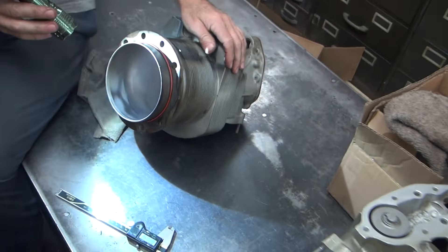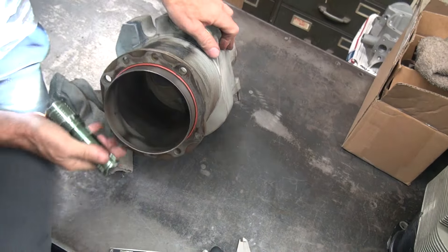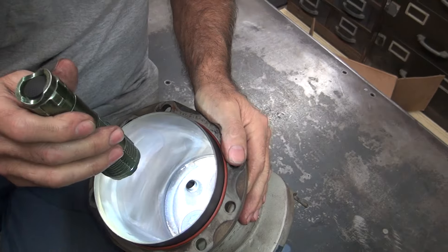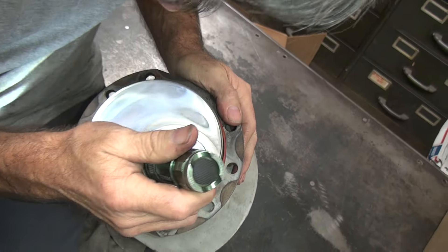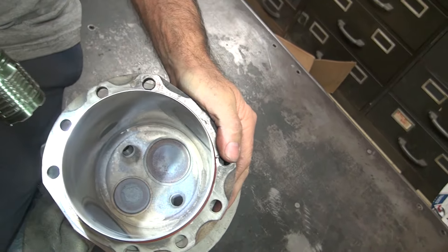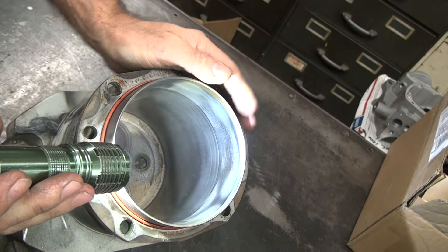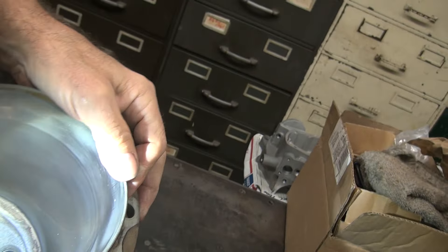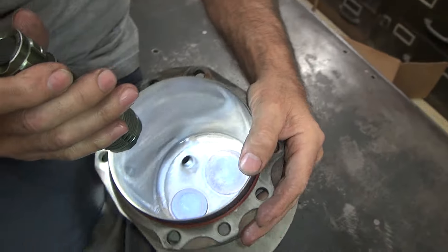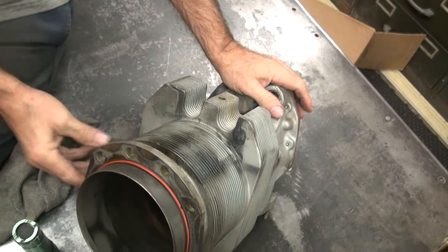I just care about the bore being good, not rusty. Looks like it was running pretty lean. Looks good — the bore looks nice. Just got to do a little honing in there. Stick a little crosshatch down the bottom still. Looks very runnable to me — plenty adequate for my bike. Excuse me, my airplane.